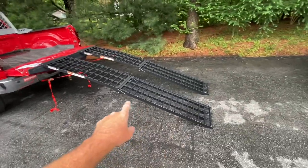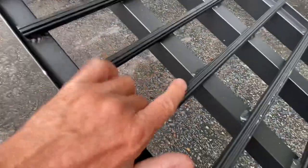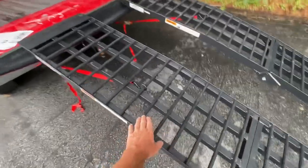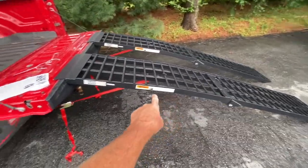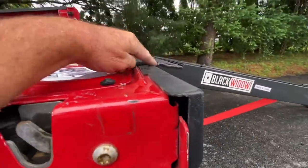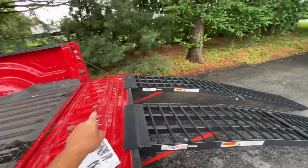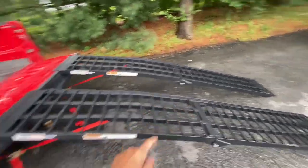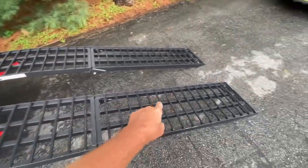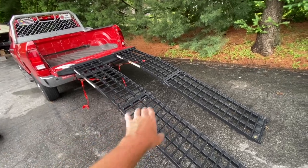Wow, that was something — it went right up there. I was purposely going slow and applied the handles to test if the traction on each rod would cause spinning or loss of grip going up, and it didn't. It made it over — the arch worked out perfectly. I'm going to recommend arched ramps. The flatness at the top is the best part: you're not going to hit the edge of your tailgate coming up. And the front caster wheels on the mower can spin and reverse direction to go back down — that gap is perfect.